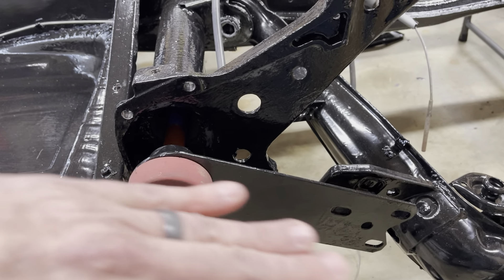That is our base rate — the natural resting position for stock height, based on that table. Now if I want to lower the back of the car three inches, I would clock the inside of the tube four degrees counterclockwise based on that table, and clock the outer part of the tube three notches clockwise, and that will give me a lowered ride height of three inches. That's a really easy way to adjust your height.